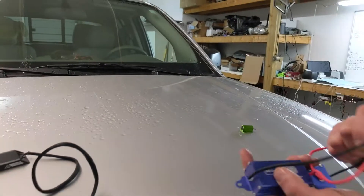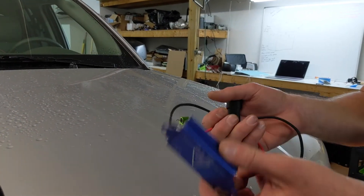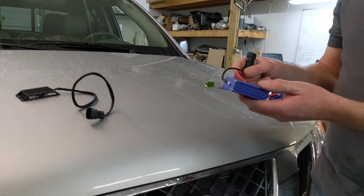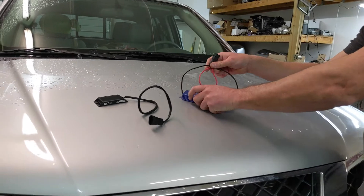Another possible option are the Morimoto load resistors. These are 40-watt, 7.5-ohm resistors. All of these will get warm to the touch — the longer they're left on, the hotter they'll get. Not really hot enough to burn your skin, but you want to make sure you mount them to a metal surface instead of plastic.